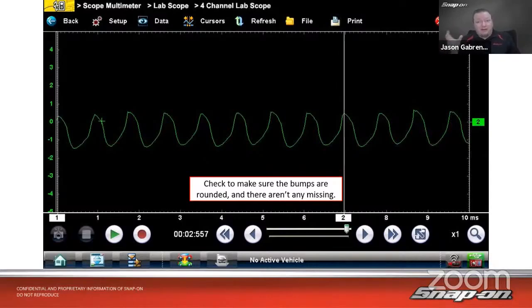Now, those are the kind of no starts you fix with a hammer. You tap on the bottom of the gas tank, right? And then it vibrates that fuel pump enough so it spins around to a good one. Then when it's on that good commutator segment, it can spin right up. Now, when it's normally spinning at its normal operating RPM, maybe it might spin a little bit slower, I suppose, but the kinetic energy of it spinning around pushes it past the one with the bad connection. So it doesn't really affect it too much when it's running.